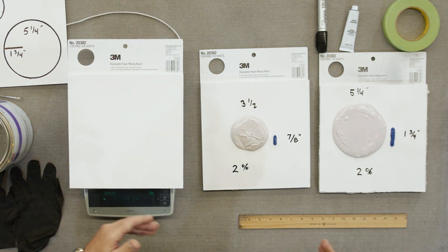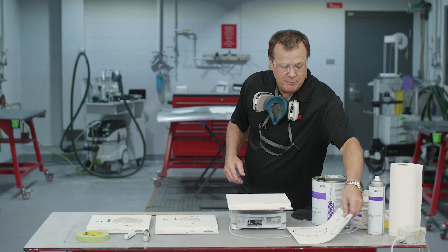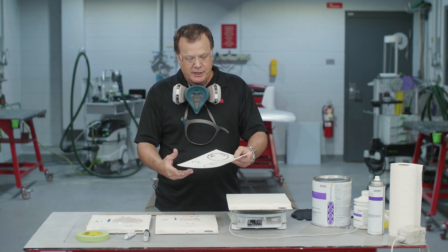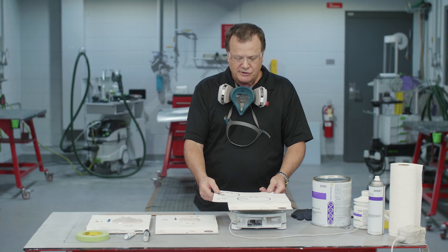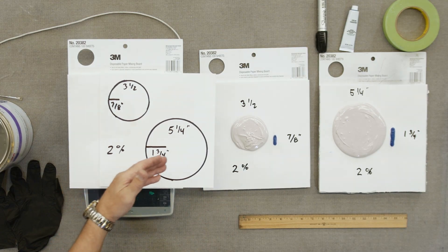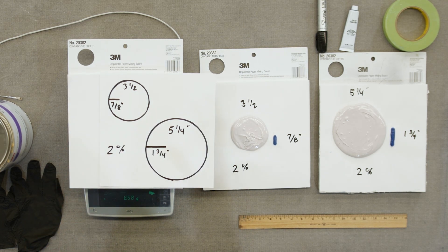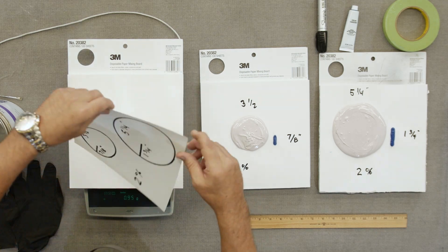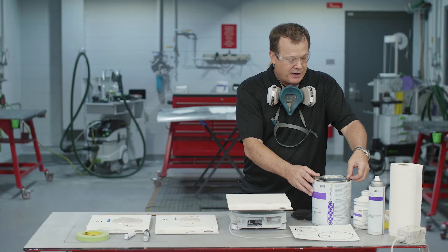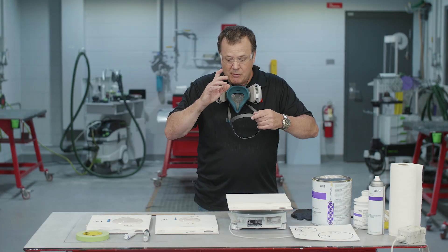We're not expecting to do this every time — just spot check every once in a while. After finishing those puddles, I measured them and drew it out so you can see — I'll show the overhead camera — what that puddle size looks like and how much hardener goes across it. Again, it depends on how you mix your filler and dispense the hardener. Let me go ahead and mix some of this up. I'm going to put my respirator on. Before I do that, let me talk about hardener a little bit.